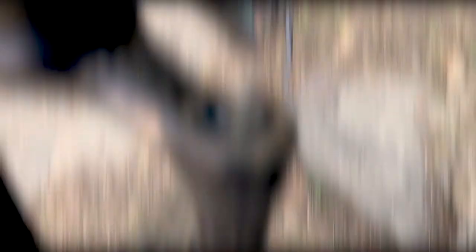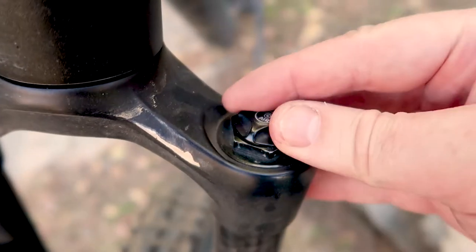If you've ever ordered a bike online and it arrives in a box, you'll notice there's no air in the forks or rear shock — you have to pump it up. That's your first and most basic adjustment. What I recommend is setting the suspension air pressure to your weight with all your gear on, then setting your sag. Air pressure plus sag setting is your first key adjustment.